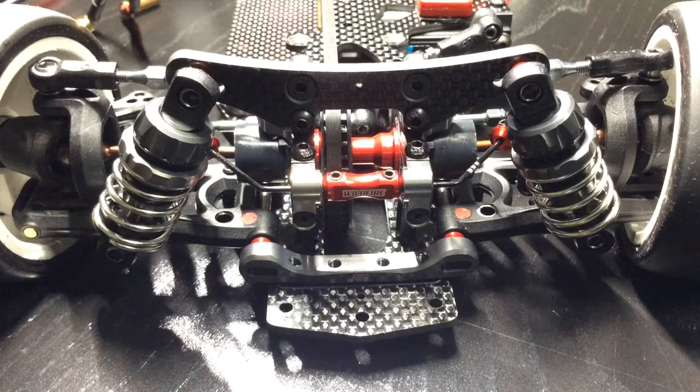So just simply change the shock angle and you'll be able to get very close to the spring rates you'd otherwise have to take the shock apart to achieve. Use the shock angles as a quick and easy tuning feature to find out what direction you need to go with your car setup. Don't hassle with disassembling shocks and switching springs — just adjust the angle and give it a try. That's why the holes are there.